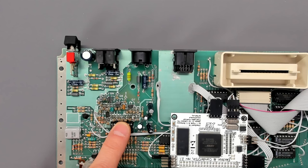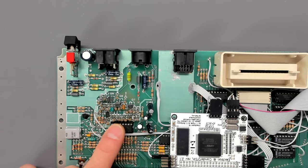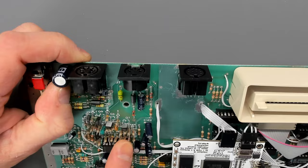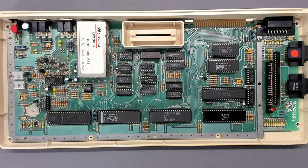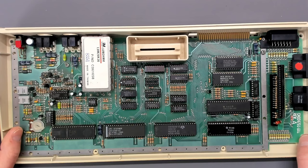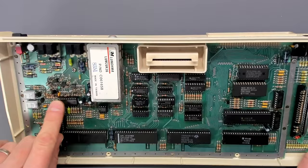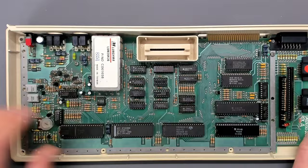There's so little space on this board that all the video circuit components are up on their ends. Stealing these components from an 800XL isn't really an option, and I don't want to start cannibalizing the other 600XLs in the collection. I've had to inventory the parts — hopefully I've got them all — because you need long component legs since one side is going to go down its length into the board. It's quite a tight fit but it works fine. This is another 600XL board from my collection — it's a PAL machine and still has the blurring capacitor — the little orange one up there — and hasn't even had a 64K RAM upgrade.